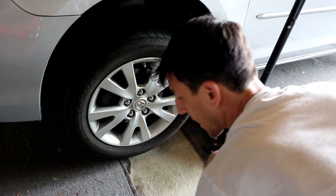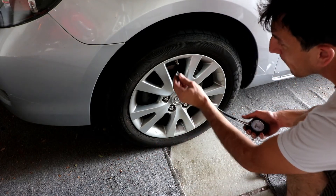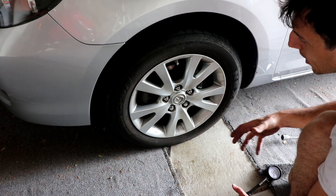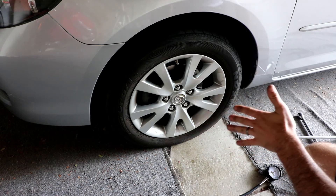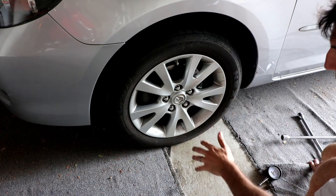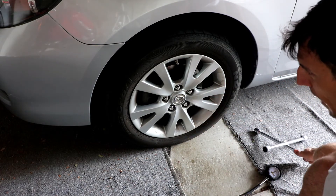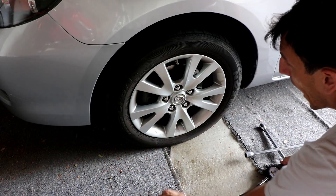Now we just got to pump up this tire. Make sure you inflate it first and check your tire pressures. This one is at 32.5 — I'm going to let a little out to get it to 32. Also remember, a hot tire will show higher air pressure than a cold tire, so check pressures when cold. The manual reading assumes cold tires — if it's hot out you could get plus two to up to six or seven pounds potentially. Once inflated, remove the jack, lower the car, and do a final pass on all lug nuts in a star pattern to make sure they're all tight. It's easier to tighten them when the tire's on the ground.